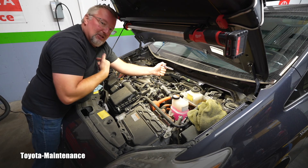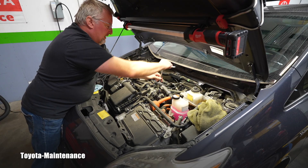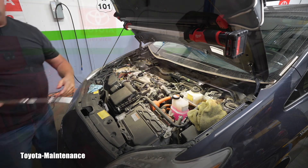Based on knowing these engines and doing this job very often, I recommend around 100 degrees of turn. I'm very happy to have filmed this short but important video — you definitely want spark plugs always perfectly torqued. Many times I've received vehicles for service where the spark plugs were loose, just sitting there with blow-by, and I can never understand how someone can pay for a service that's not done correctly — it could cause misfires or other problems.